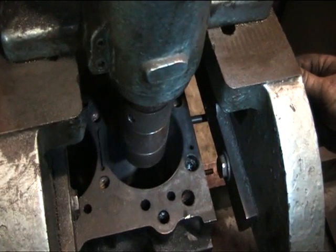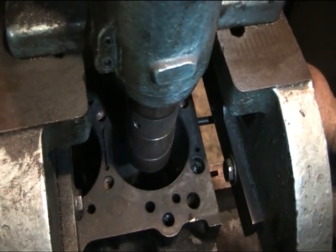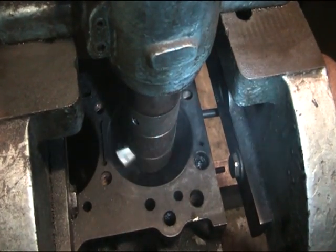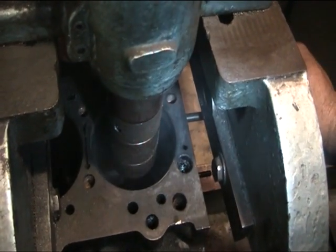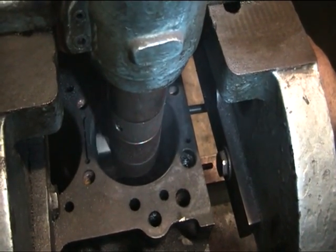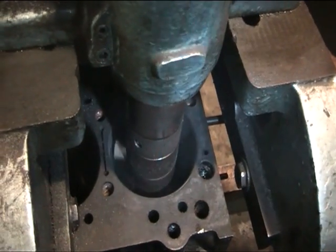The bar progresses at a set speed down the cylinder bore so it cuts all of the cylinder walls to a pretty nice finish. As you can see the bar is catching all sides of the cylinder, progressing down nice and evenly. That smoke you see is actually the carbon coming out of the steel. This is an oilless cut because the cylinder bores are already impregnated with oil from running.